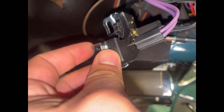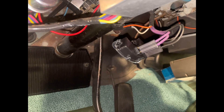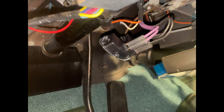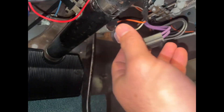Alright, got it all hooked up — power, reverse. Here's your nub — this is the important part. The car's been parked and this piece of metal coming from the steering column has to go into the slot. It's important that it goes into that slot. If you don't put it into that slot, you're essentially doing nothing by installing this neutral safety switch. So it's important that you get it lined up. Once you have it lined up, the car should turn. Right now it will turn because I have the neutral safety switch in the correct spot. If I were to slide that notch over, I'd have the same issue — it would do nothing.